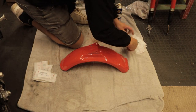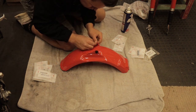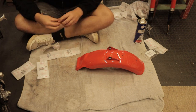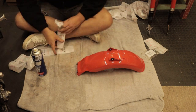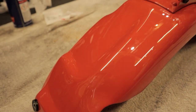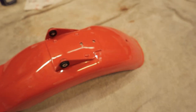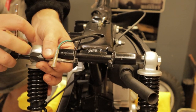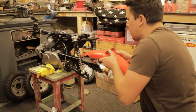One of the things I definitely overlooked in this whole restoration process was the smaller parts and pieces needed to do a good restoration. All of these grommets had been sitting in the sun and had the moisture taken out of them — all the little bearings and bushings are knackered and you need to go around and replace them. It takes a long time finding out what you need to order, and it's actually quite expensive because by the time you buy all the OEM parts it adds up. But it is extremely therapeutic putting fresh parts onto these painted panels. And with the painted panels come threaded holes — just to save us pain down the line, we're going to run a tap through all the painted nuts so we know our bolt fits nicely.